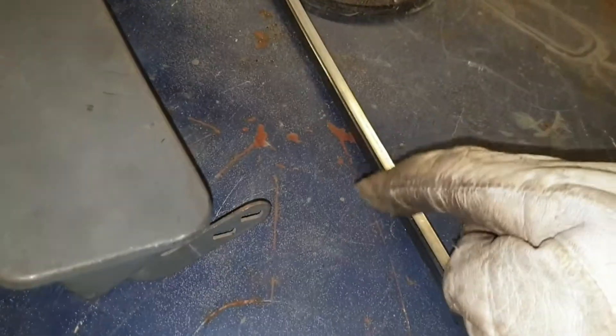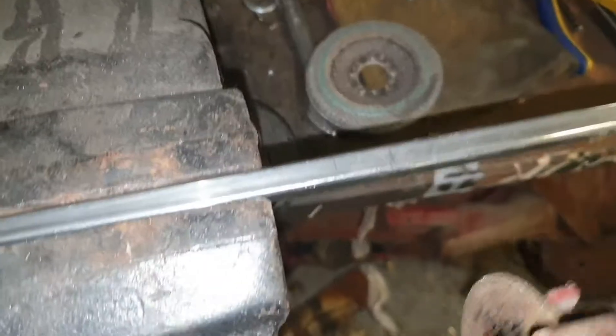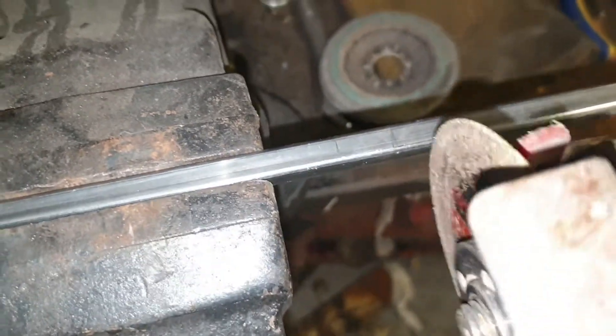I'm going to make this side fit now, then chop the top off and end up with a U-shape, which is the bit I want for the drip rail. If I'd done it as a U-shape and tried to cut it, it would have just deformed in all sorts of directions — an absolute nightmare. Because I've done it in a box shape it's holding itself nicely. I've just made two marks, going to pie-slice now — loads of cuts — then put a bend in it.